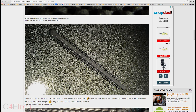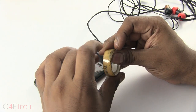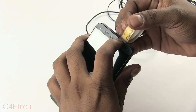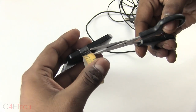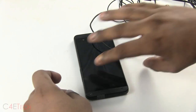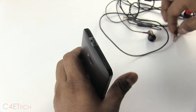So this is the last option if nothing else works for you — just get some tape. Let me take the case off. Get your SIM ejector pen handy as well. Take some tape, turn the phone off or just turn the screen off, stick it on top, and just cut it — as minimal as possible. Take it off, cut it, smooth it out, and now take your SIM ejector pen and just poke a little hole there. Now just plug your earphones in.